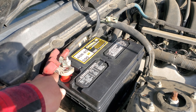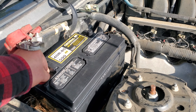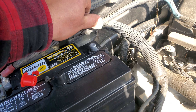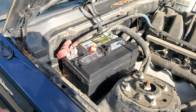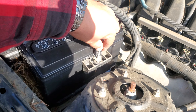Once you have the battery in there, go ahead and remove these battery terminal protectors. Maybe I should have done that before the battery went in. Let's go ahead and take both of them off. We connect the positive one first, then the negative. And the next thing we're gonna do is put this battery clamp back into its place right here.